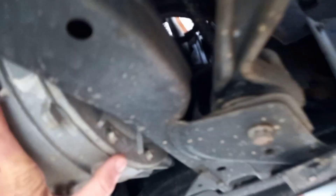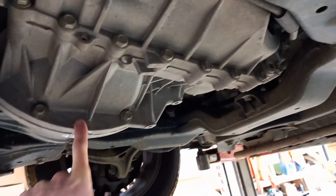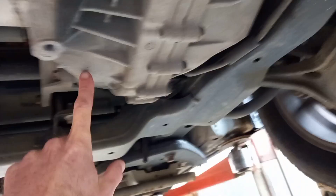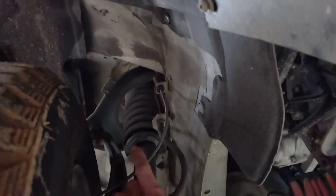Now we've got the car in the air and going in from the front - that is the motor. And my God, is it a big motor. It's not as long as a Tesla but it's a bigger diameter - it's a beast of a thing. There's a fairly big transmission too. It's almost like a conventional bell housing gearbox mount. It'll go into some kind of reduction back here to the diff and out to the sides. You can see why people say it's like a Honda on the suspension - it's got a strut and a swing arm at the top, kind of Tesla-like as well. It looks like we got ourselves a bargain basement Tesla - sure doesn't drive like one.